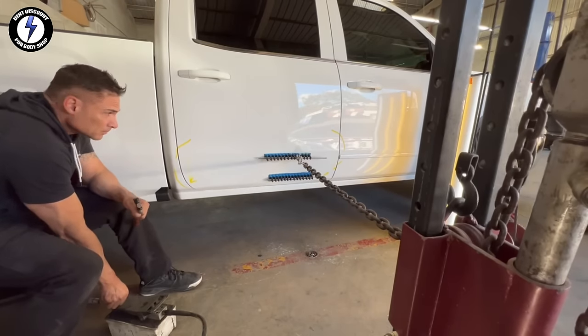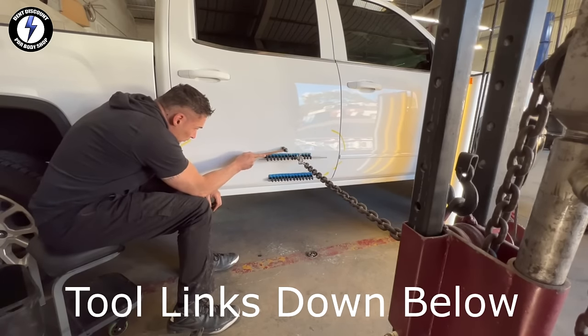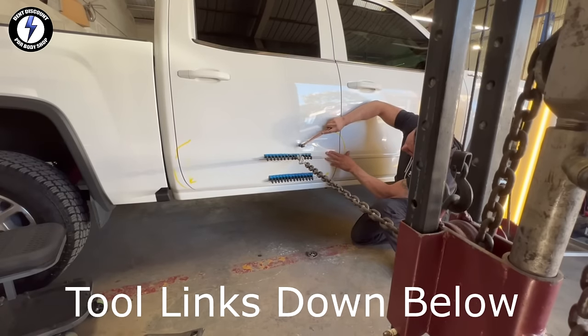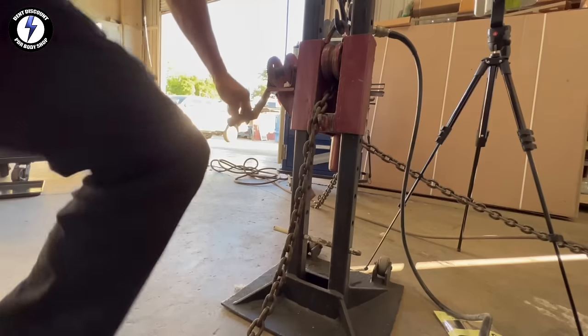Next, I grabbed a simple 4-ounce Ballpeen hammer. I'm looking down the side, watching the crown go down and the dent come out. I placed a square piece of Gorilla Tape on the flat surface. This allows for a softer surface and it will not scratch the paint. This is a great car hack if you can't afford a paintless dent repair blending hammer.